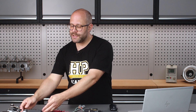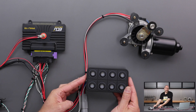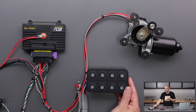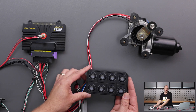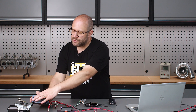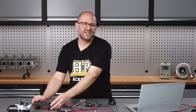Let's have a look at setting up one of these keypads and show some of the excellent features you can take advantage of. The example we'll go through will once again be controlling our wiper motor, but this time using our CAN bus enabled keypad. This is sold by ECU Master along with their PMU 16, so there are really excellent linked CAN profiles in the software. This is a Blink Marine PowerKey Pro series keypad. On the back we've got nice simple mounting, a membrane for sealing, and the whole unit itself is sealed as well.